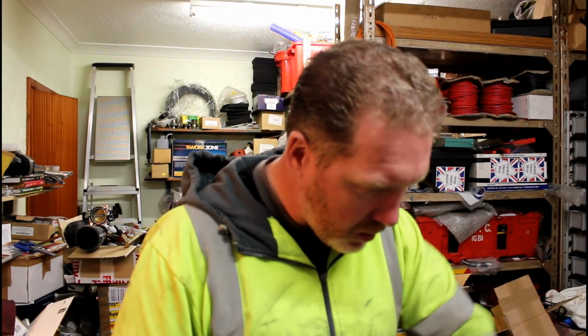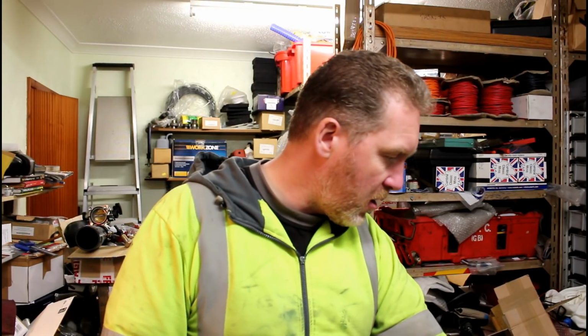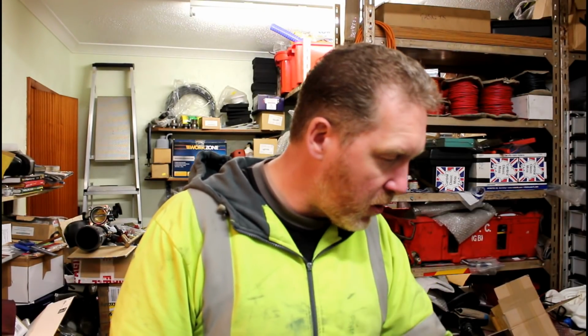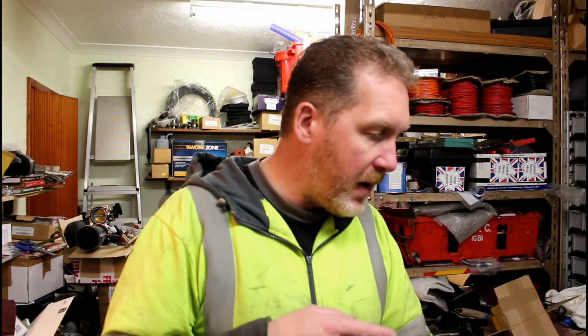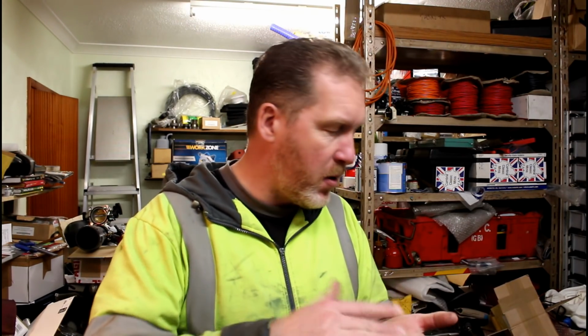Last night I got the clutch all cleaned up because it was a bit grimy and it had gone rusty with sitting with salt and crap in it. So the clutch is all on. So that's pretty much it for the engine block for the moment. I need to do a lot of painting on it, give it a fresh coat of paint because it's looking pretty grotty where I've cleaned it off and rubbed off the paint. And I also need to see about getting the cylinder head done yet for the dry decking. I'm sort of half tempted to just do it myself because it's just an alloy head. I've just got to drill a hole the right size in it. It's already got a flat end on it, so there's no need to put it in the milling machine.